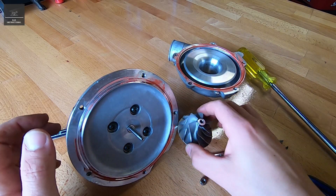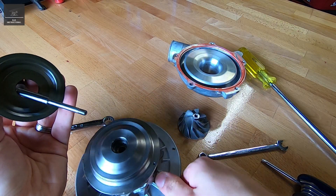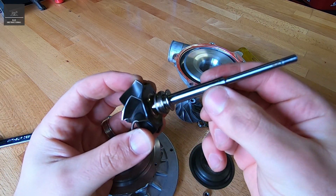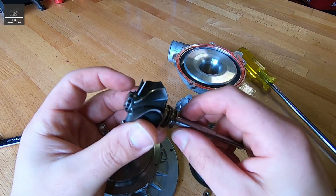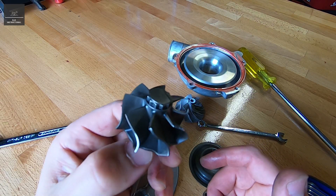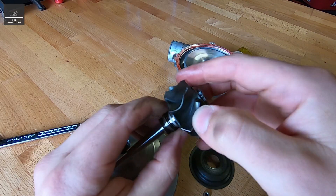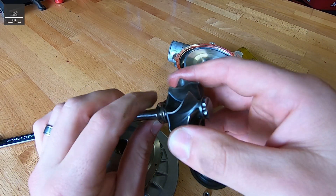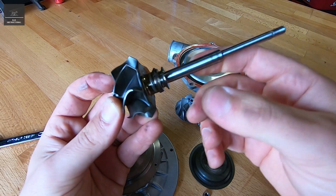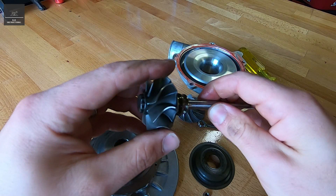It's quite a shiny face — and now this should just slide out like that. So we've got this cover plate, and we've got a shaft here that's stepped down as well. We've got some sealing there, and we've got the actual exhaust turbine. Now in a more modern diesel engine, you might hear something like a variable-vane turbocharger. On the exhaust side, these vanes here can actually change angle or pitch — so they can make more boost at a lower engine speed when there's lower exhaust gases flowing through the turbo. That can give different power characteristics, a flatter torque curve for example, and spool up quicker. So a few advantages, but this is obviously very basic.